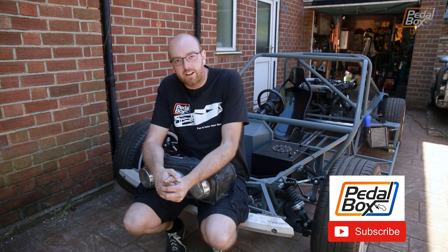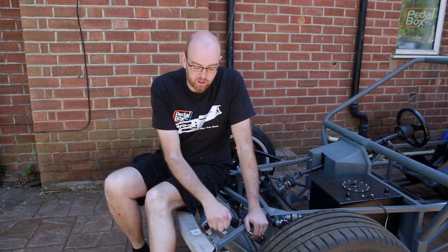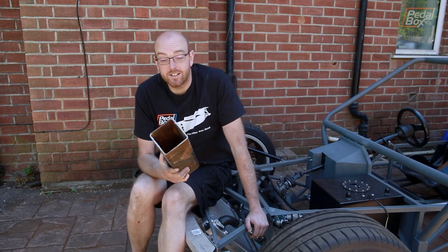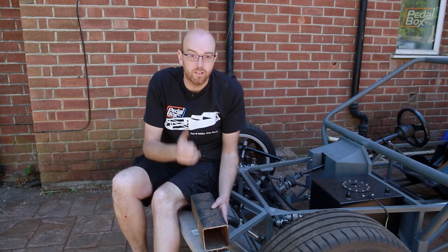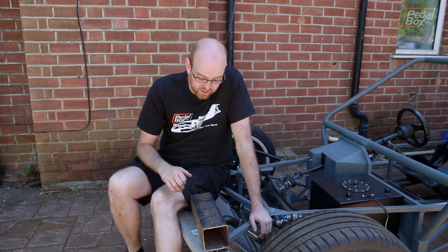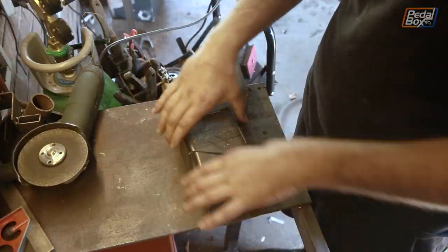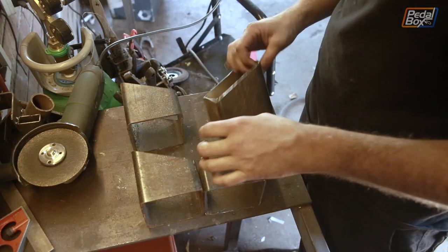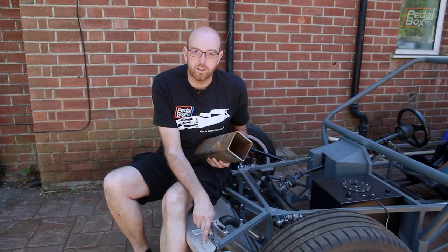That means we're extending the length of the car ever so slightly. So how are we going to add eight inches between this plate and this plate, where we've got our Audi crash bar going onto our radiator mount? Well, this is probably overkill — in fact, this is definitely overkill. But this piece of steel, which we got from Berkshire Mantle's scrap pile, so thanks to them for helping support us — we're going to cut into four pieces and weld it into a double trapezoid shape, welded along the shortest length. That'll give us a four-inch by four-inch plate on each end, spaced out eight inches apart, to then re-drill and bolt these two.